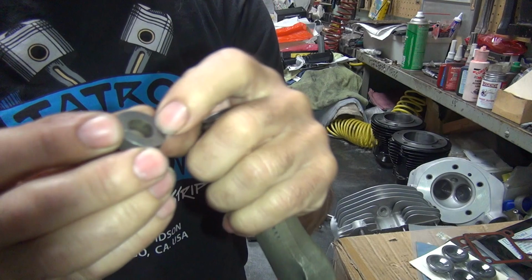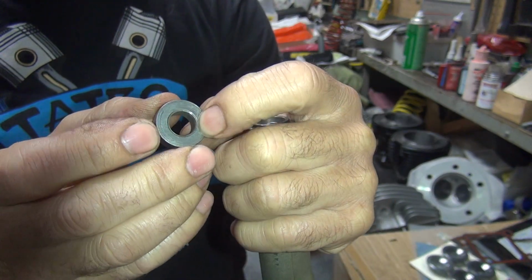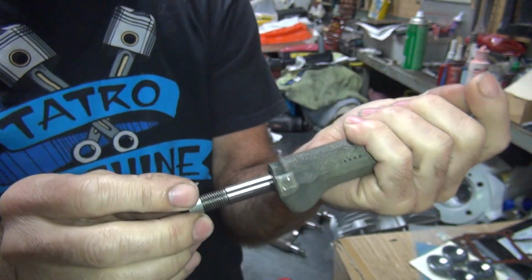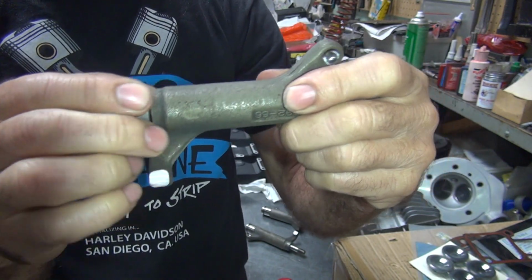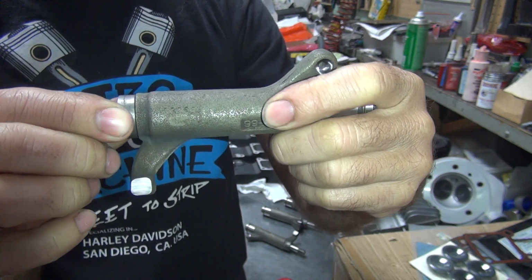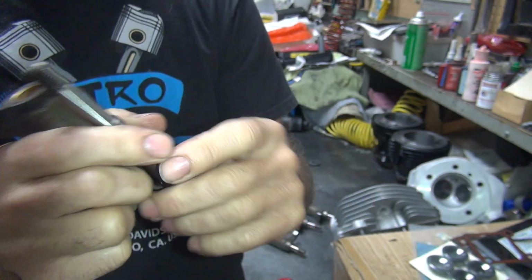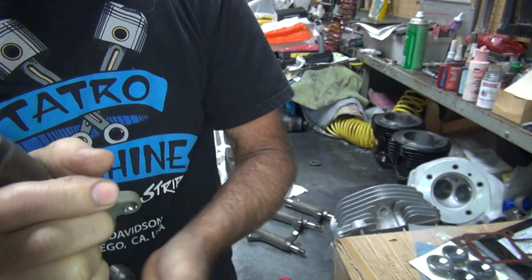When you look at these, you've got to look at the chamfer in here. This one's flush. This one here has a little wear mark in it. So if you put it against this way, it'll be slightly tighter than if you do it this way. So we'll check it the loose way first. See, it has lots of in-play. Flip around, check it the other way, and it's usually slightly less. This is our loosest one. Now you can shim this up, or you can cut the shaft down right here just a little bit and tighten it up that way.